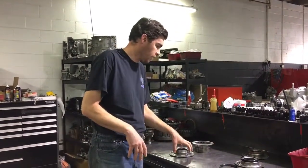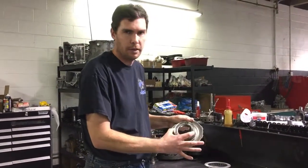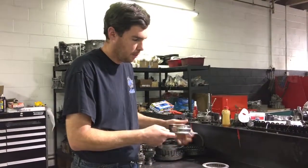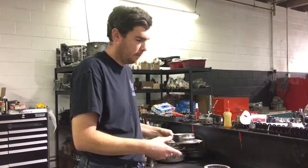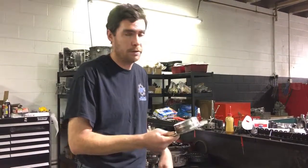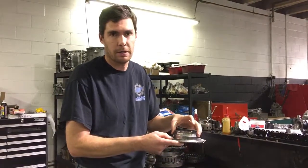The seal that we designed is pretty ingenious in that it uses a steel sleeve, which actually presses over the factory piston housing assembly. So that way you don't have to buy the whole billet piston assembly, which saves a lot of money. In the past, it used to cost $1,200 to $1,500 for just one piston because the whole thing would be billet to fit the aftermarket seal.